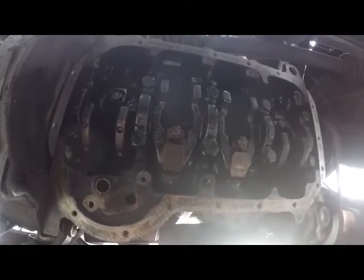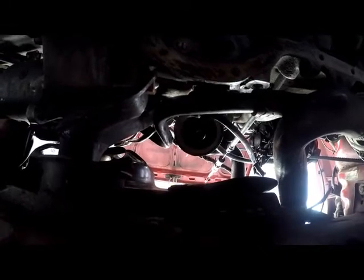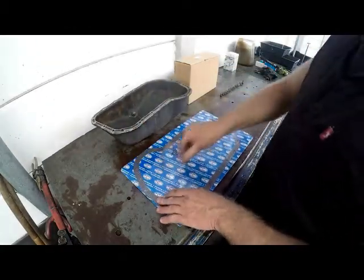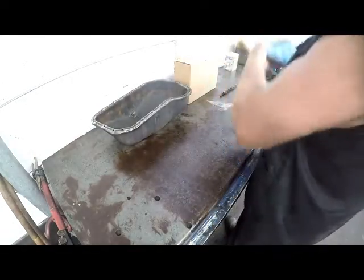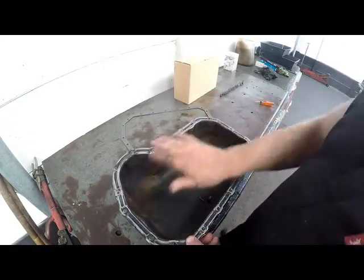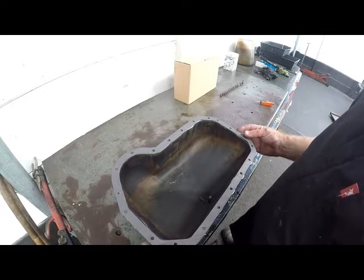This is all ready for the new oil pump and the new sump to go on. We're going to get the parts and then assemble this whole thing. We've also taken off the oil filter — we're going to be putting on a brand new oil filter as well, along with clean oil. So I'll get back to you once we've got the new parts ready for installation. We've got our parts here, so let's open up this package for the sump gasket — make sure it's the right one for this vehicle. All the surfaces are nicely cleaned up. Overlay the sump gasket on the sump itself, making sure all the holes line up nicely.